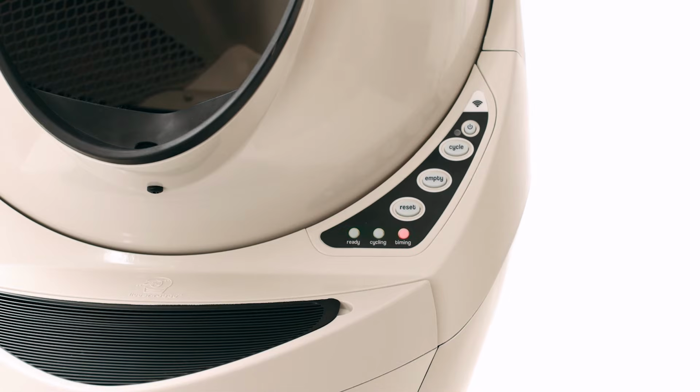Flashing sequentially, 1 light at a time, red, then yellow, then blue. This means the unit cannot find the home position. It will continue to function in automatic mode but needs repair.